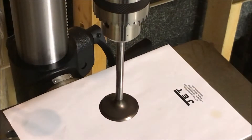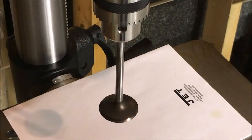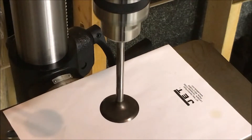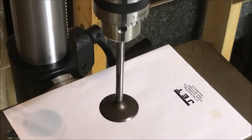This is an intake valve. Let's see how this spins. And that one is looking pretty good. So we have a good point of reference using this one — that looks to be just fine. All right, here's our second intake valve. Let's see how this one goes. Whoa. Wow, look at that. That is definitely bent. Compare that with the one we just saw — we can definitely see some wobble in this. That is a bent intake valve. Not as bent as the last one, but still clearly bent. You can definitely see a wobble there. Not looking good.